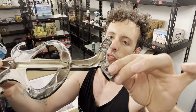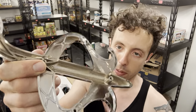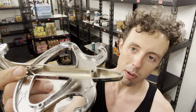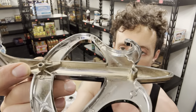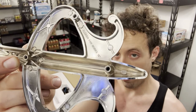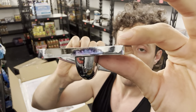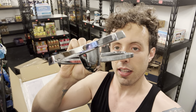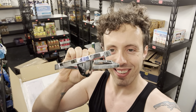Your blade irons here are made out of cast aluminum, which is extremely lightweight. Most blade irons are made out of zinc — we went with aluminum because it's so lightweight, it allows the fan to spin at a higher RPM and move more air. Aluminum is very strong — remember, they make airplanes out of aluminum. This is a 15-degree reverse pitch on it. You can see just how steep that pitch is — isn't that just gorgeous?